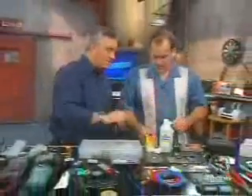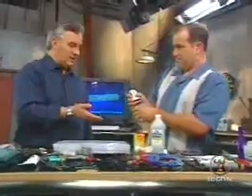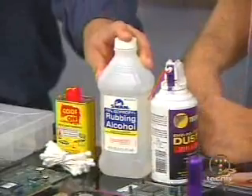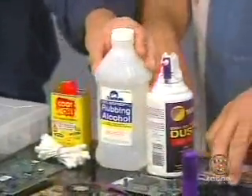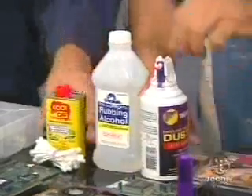I see you have some cleaning stuff here. This is important to have as well. You've got your canned air — that's for blowing out dust, cleaning the keyboard, and discovering big chunks of gray cat hair stuffed inside a fan. A little bit of rubbing alcohol — though you might want to find alcohol that is not denatured and doesn't have the glycerin part.